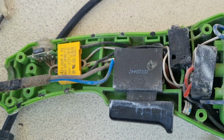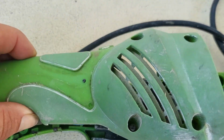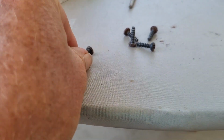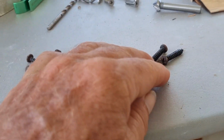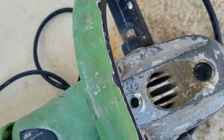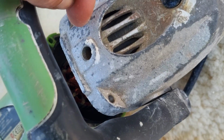see how she goes. So to get this apart, basically this unit here simply screws over the top with 2 long Phillips, 4 short Phillips, and on the end, which I took off as well, which I actually didn't need to take off, but if you have a look, there's 4 big simple Phillips screws that go in there.